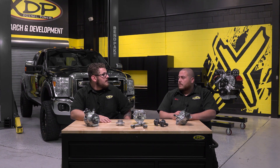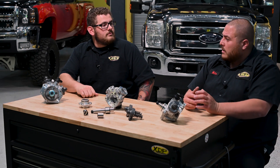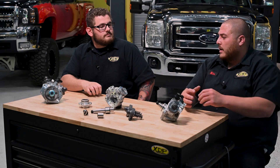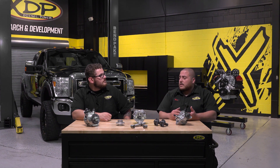If you're driving down the road and feel those symptoms and have a failure, what does that look like cost-wise? Cost could be roughly around $10,000, somewhere in that ballpark. There are kits out there that supply most of the components you'd need, though you may have to add a few things. Labor-wise it depends on the truck's condition — whether you're changing components like fuel supply lines and fuel coolers. You're still looking at a 10 to 12 hour range, maybe longer depending on the full scenario.